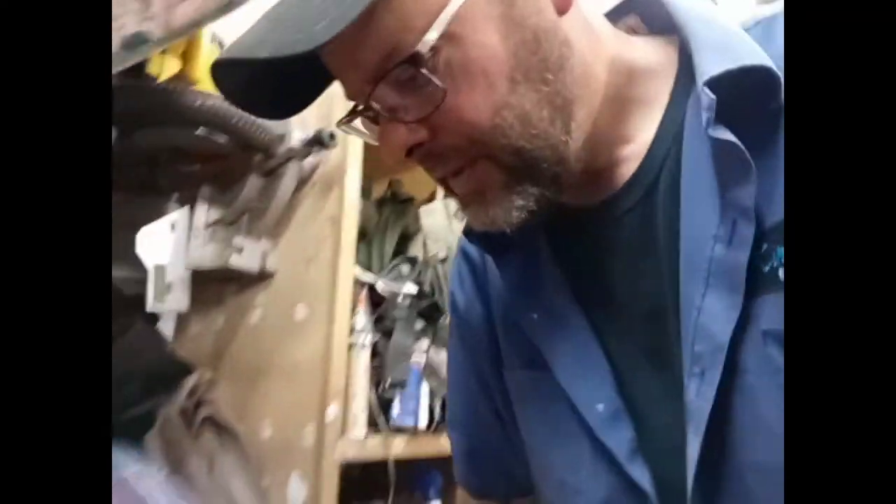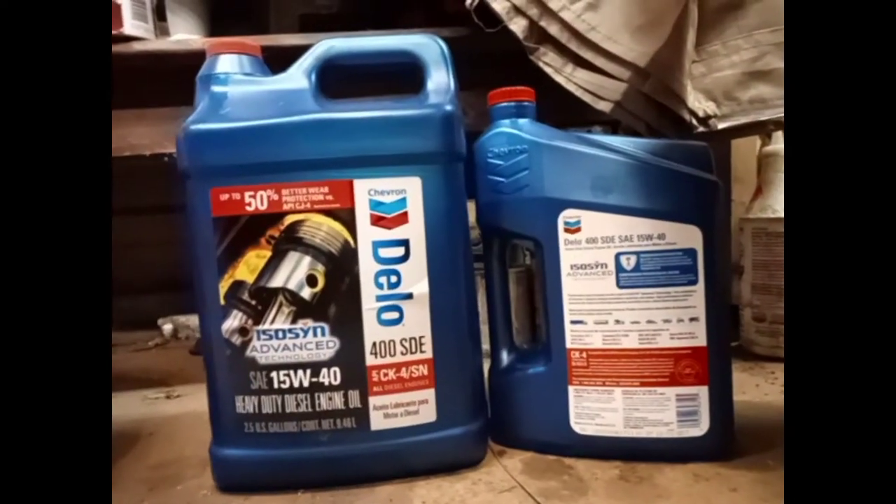Let me show you what I'm actually putting in it — right there. Some people simply won't run that; they want to run like Mobil 1 or something. I like Schafers. We're gonna run Schafers in it probably — a straight 30 weight. We may go to 10W-30, 10W-40, or 20W-50; I don't know, we're just gonna have to play with it. It has really good oil pressure — 40 or above at idle, and it goes up to 70 to 80 pounds when you bring in the boost on a pass.